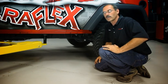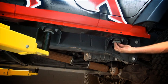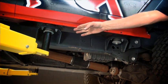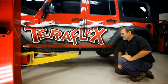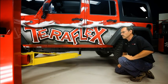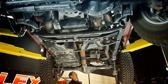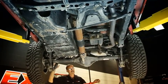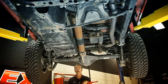If you're lucky enough to have a hoist where you can take the top off and use one of these arms, they work great. You can just catch them right on that nut and it indexes on there and holds them really solid. I've put it under that middle body mount to make sure we've got access to the back. It looks like it's a long ways forward, but when we get it up in the air we'll just throw a jack stand on the back and she'll be solid. By adding this jack stand to the back of the Jeep, it really brings a lot of stability to these hoists. We want it good and stable because we're going to be doing a lot of cutting and welding and twisting — we don't want that Jeep moving on us.